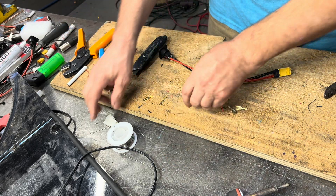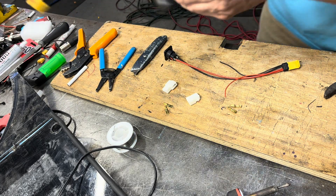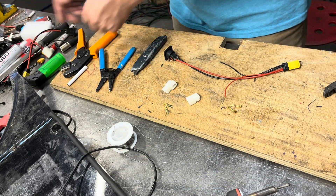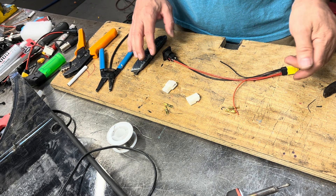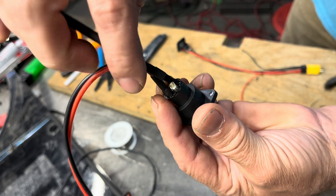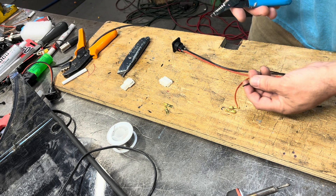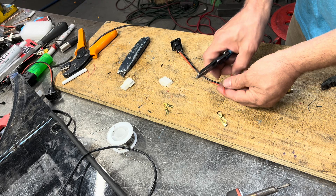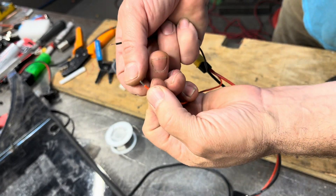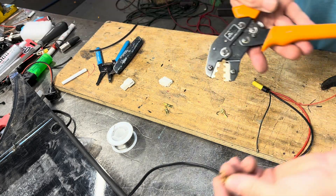Sometimes I've got to use big pliers but that one clicked right on. Now I've got the spade connectors — I think they're 6 millimeter spade connectors. On this side this will be the battery side — I always put my red near the clips or if there's a line. Don't forget to put on your heat shrink — you have to put that on the wire first. I forgot to do it on this one but that's okay, I'll redo it. Let's show you the wago connectors real quick — just clip that, clip that.